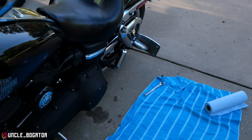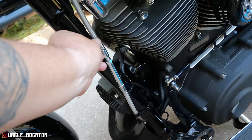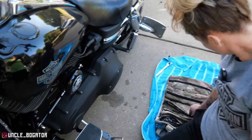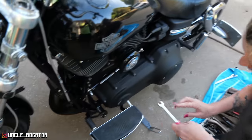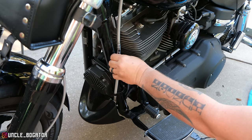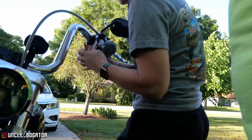Yeah. Okay, first thing you're gonna do, grab my toolkit there, and you're gonna find two wrenches. Basically, we're gonna loosen up the clutch cable. So we're gonna run this in to make it loose. After your bars were done, we haven't readjusted the clutch anyway. Inside of the primary is fine, should be. So this will give us the opportunity to make sure we adjust the clutch anyway. All right, so we'll make this loose. And what that'll do is you'll see your clutch cable starts getting super loose. See how loose that is now? Yeah. That's tightening. Oh. And it is? Yep. You're upside down, so you have to look at it the other way. Yep, there you go.